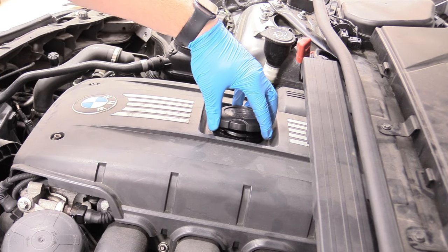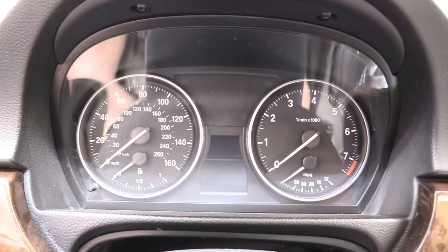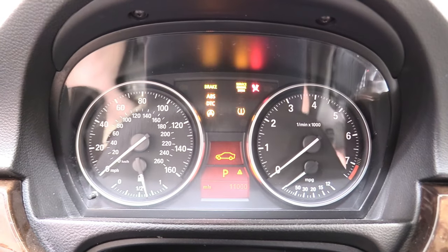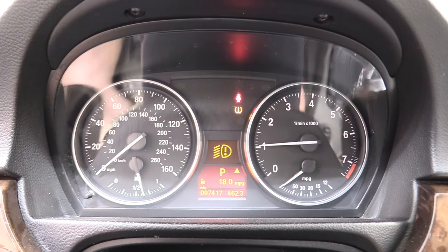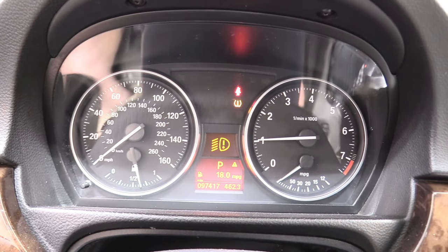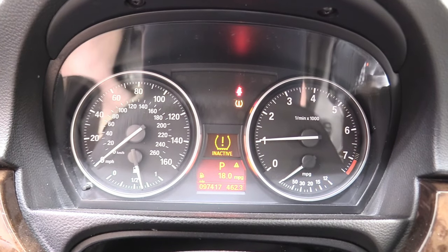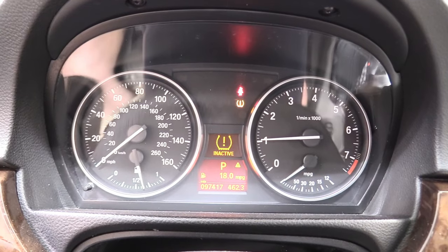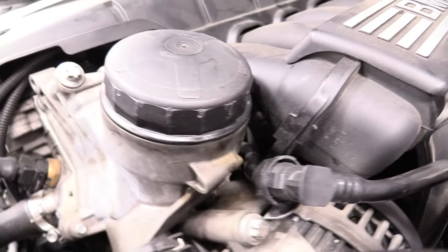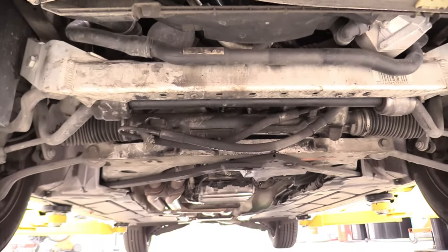We can replace our cap. If it doesn't go on right away, try twisting the body around until it does, and then you'll hear that nice clicking sound and you know that's done. In order to make sure that it does have oil in it, we're going to turn the vehicle on. It might have an oil pressure warning light — don't worry about that. As soon as it goes off, like it just did, that will tell you that it has oil pressure and it is happy with the volume in there, because it does have an oil pressure sensor and an oil level sensor. So if there was something wrong, it'd be blinking, much like the tire sensor is blinking right this moment. But it's not, so 7 quarts is right on the money. At this point, it's a good idea to look at your oil filter and make sure it is not leaking at all — which this one isn't, it is perfect. Also a great idea to look underneath and make sure it's not just dumping oil all over the ground — which it's not.